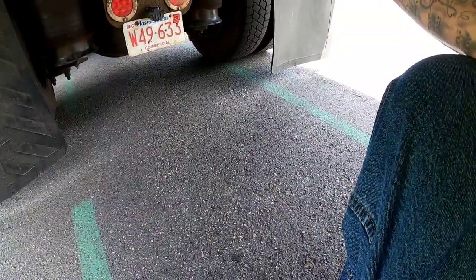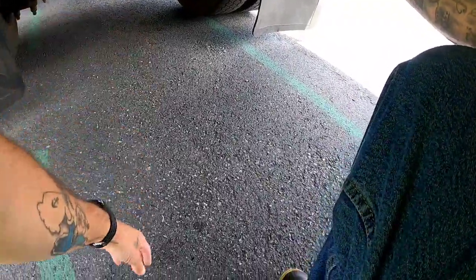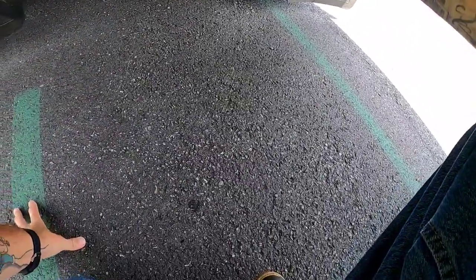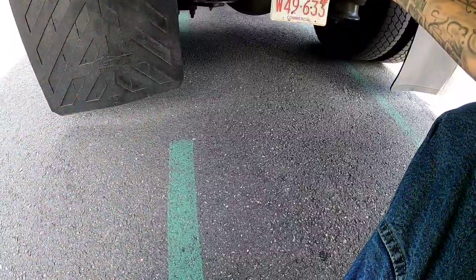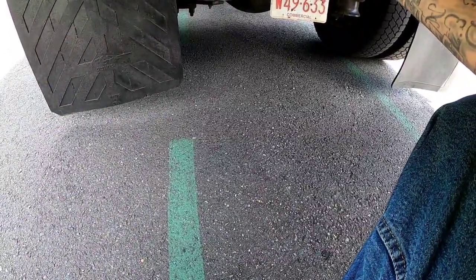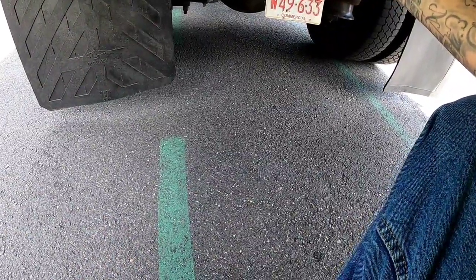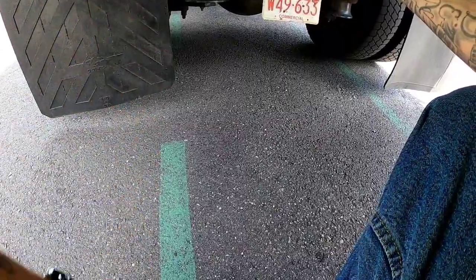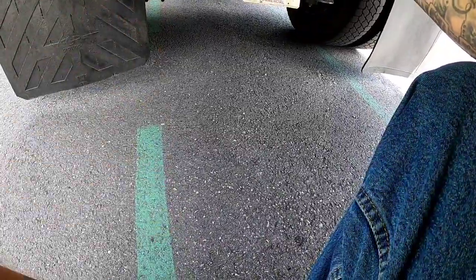My tractor taillights, flashers, and plate light are all working. The plate is secure with a valid registration sticker. Onto the suspension here. My control arm hanger is not damaged, and the control arm is secure. There are no cracked, broken, or missing leaves, and it is attached securely to the axle with 2 U-bolts.